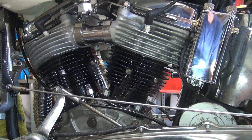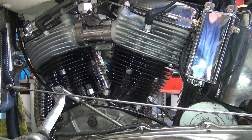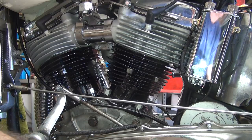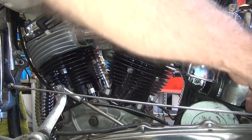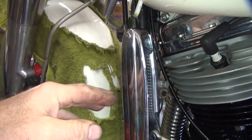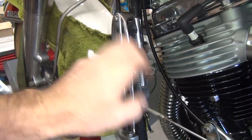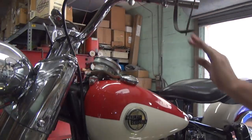We don't have hardly any free play in here, which is a little bit tight. But everything's kind of worn out so it's about right. You can see how the clutch is not coming back up on its own - that means we're out of adjustment. We've got to get it to come over to the top. So we've got to take out some more of this free play here. Okay, you pay attention to this Mike - you've got to adjust this yourself later. We're taking out some of the free play up in here. Right now the clutch is not returning - so I'm getting it back to like we used to have it.